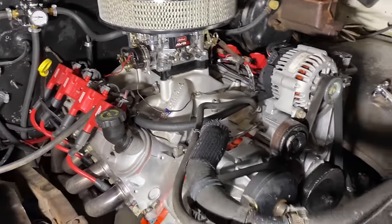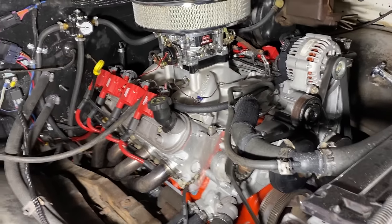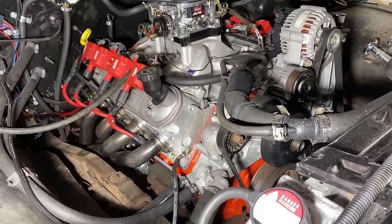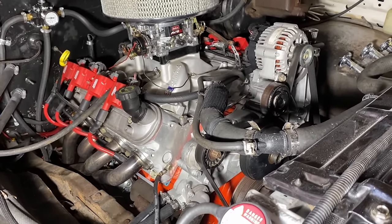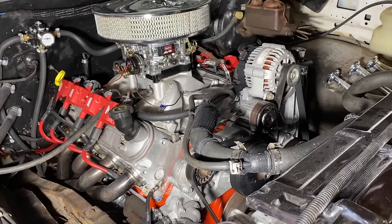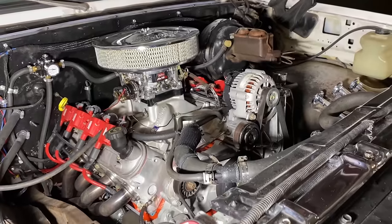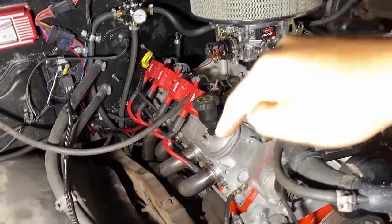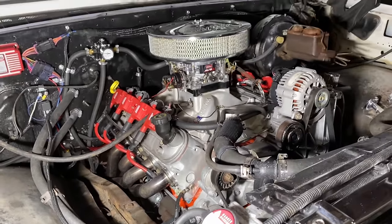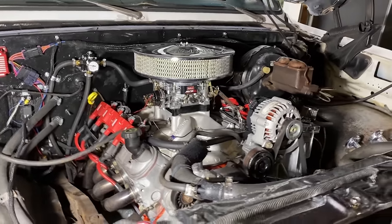You need the valley cover because you get rid of the knock sensors. I put the motor mount plates in the stock small block location, so the transmission and driveshaft were in the stock spots. I didn't need a different cross member or a different driveshaft length. If you put those in the stock small block spot, you don't need to change your transmission cross member or driveshaft length — just remember that.